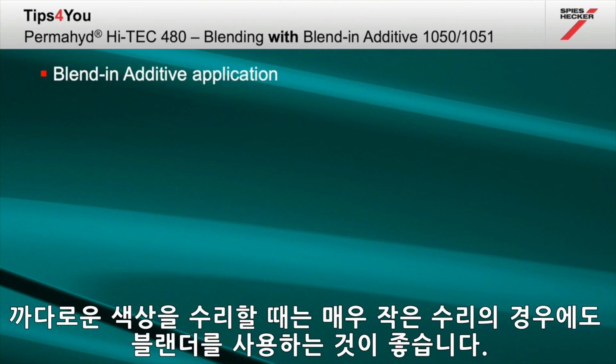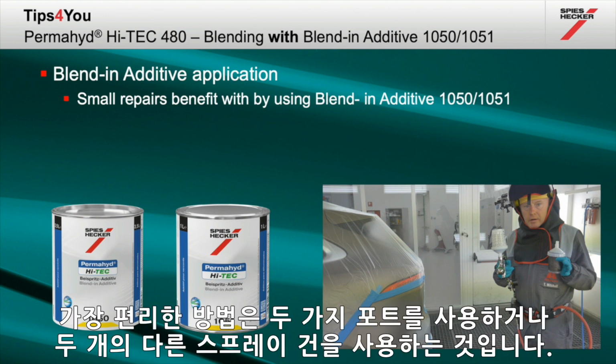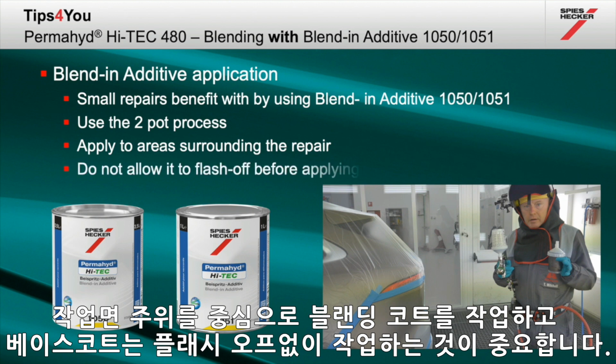When repairing difficult colours, even the smallest of repairs benefit from the use of the blender. The easiest way is to work with the 2-pot process, or alternatively use 2 different spray guns. Apply the blender to the areas surrounding the repair and do not allow it to flash off before applying your base coat.